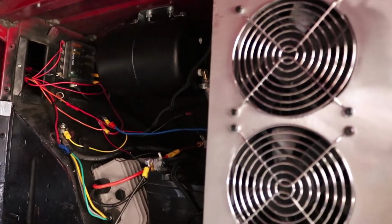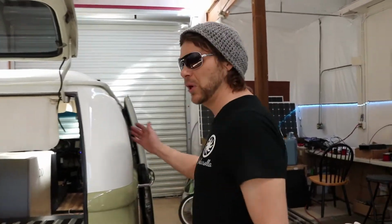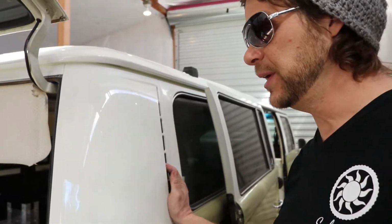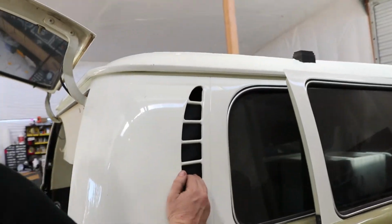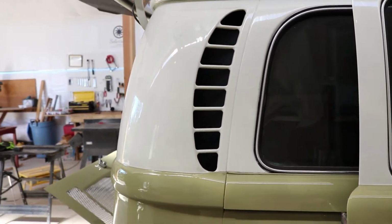So that'll be set. We have a nice air-cooled radiator in there that the fluid travels through, so when you're coming down the road, it utilizes these VW scoops, which normally used to cool the gasoline engine. The air is going to come down and blast right through our radiator for our cooling system.